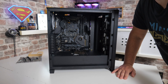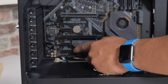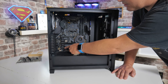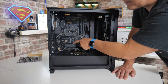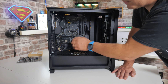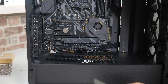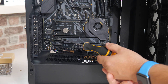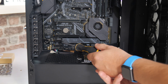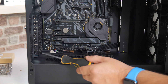When it comes to your actual computer, you will need PCI Express ports such as these ones at the bottom. It works in a PCI Express Gen 2 or above slot with an x1 connection — that's the smaller ones. You can also use it in a larger 16x slot, and even if your slot is only wired for x8 or x4, it'll still work as long as it has PCI Express x1 connectivity. I'm going to be installing a 2.5 gigabit Ethernet card as well, so I'll put the USB card in the bottom x1 slot and use the slot above it for the network card.